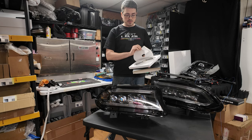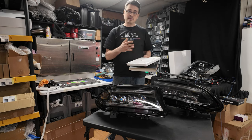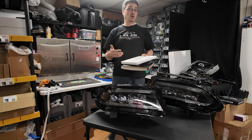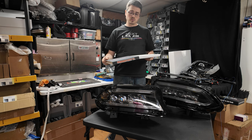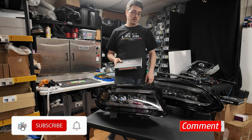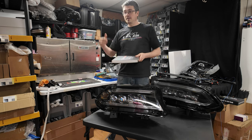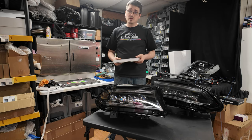And this is usually enough to do at least a full set of lights if you had PermaSeal originally. And if your lights had butyl originally and you just wanna top it off a little bit to prevent leaks, it won't take a whole lot of this to do that. So one roll will go pretty far. I would say in most cases, you can do almost two sets of lights with PermaSeal. But we'll go ahead and get that put inside the channels. The oven's already preheating. I'll go ahead and disconnect some of this electrical and we'll get these things sealed up.